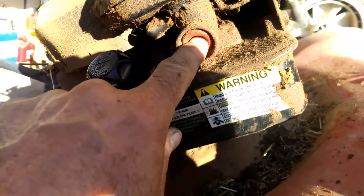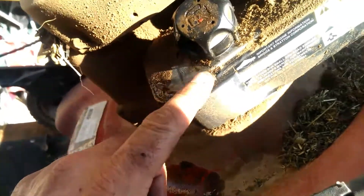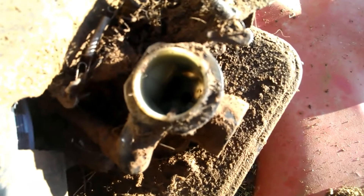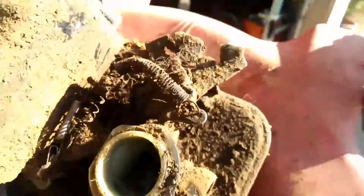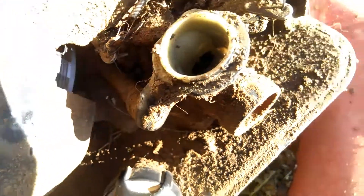The primer is sun-baked in there — that's a given. The gas tank does have its little cork seal in there, and the gas is actually helping to clean this off a little bit. Looking down inside the carburetor, it is actually pretty clean. It wasn't sucking a lot of dirt in because they did have the filter on it. The filter can't breathe at all — it's totally clogged — but there's no oil stuck down in the bottom. Generally if there's a ring problem it'll blow by and leave a deposit down in there.